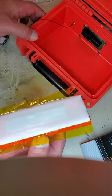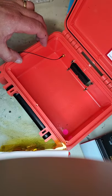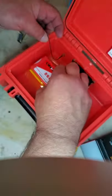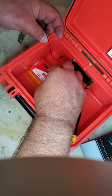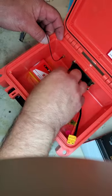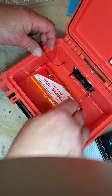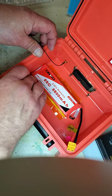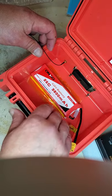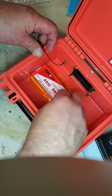At that point, remove the foam backing and put the battery in the middle against the left side. Just set it down on the plastic and push it down fairly hard. What you don't want to do is poke it on the sides — these sides are the most sensitive part and can make the battery stop working. Just give it a little bit of pressure on the top and it'll seat.